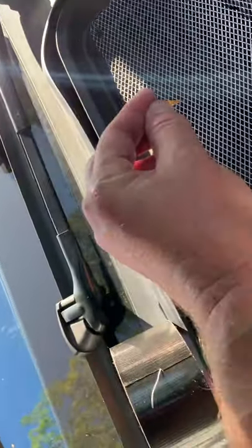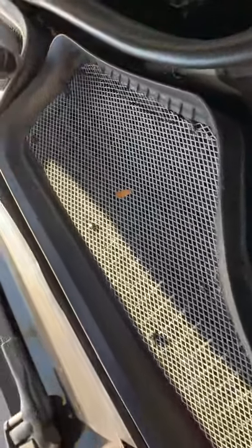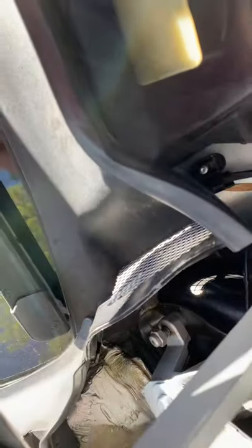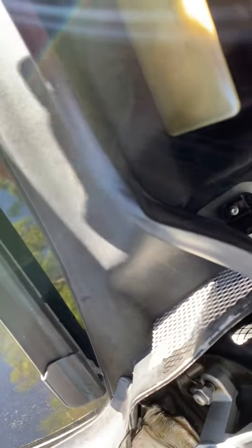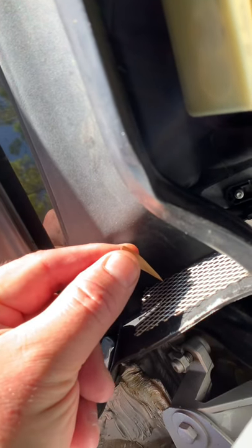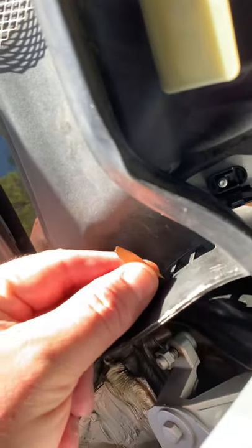And now, with this metal mesh, they're just going to fall on it like that, and they're not going to make their way down into the drain that's at the bottom of the AC intake. Every once in a while I'll pop my hood and collect these little suckers and get rid of them. Same thing over here — they lay all along this cowl. I got a little battery-operated rechargeable blower from Harbor Freight, a little red one, very powerful. I blow these things off the cowl and any leaves sitting here. But without the mesh, these things usually slip right down through those drains.